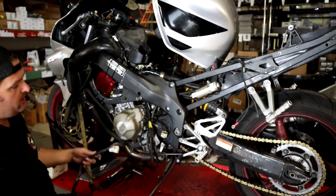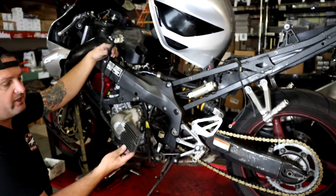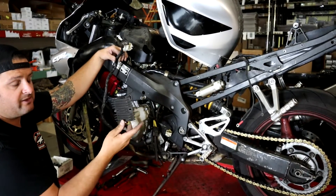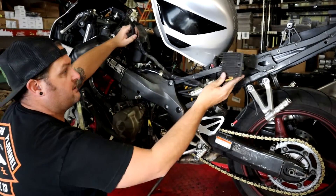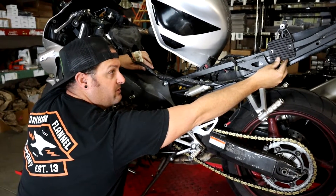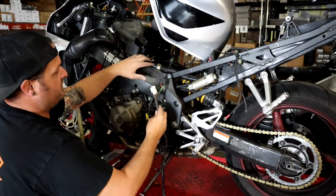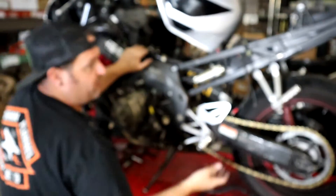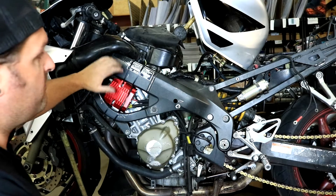If you're installing an OEM regulator — which we do sell as a plug-and-play OEM-type regulator exactly like the original, and also in a MOSFET version — it'll fit underneath the back fairing and plugs right in. If you want a totally plug-and-play installation, we have that version available. It's the exact opposite of what we just did: mount it back here with two bolts, run your wires alongside the frame, and plug in your connections back here behind the frame. We're not going to detail it — it's very simple if you've gotten this far.